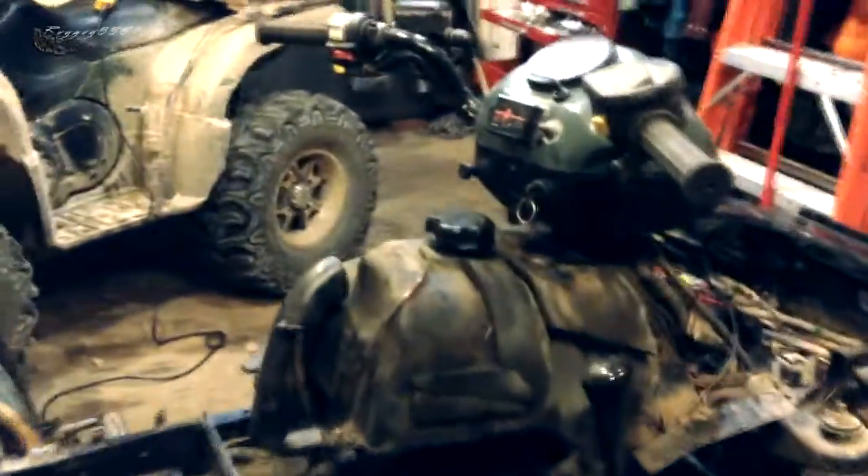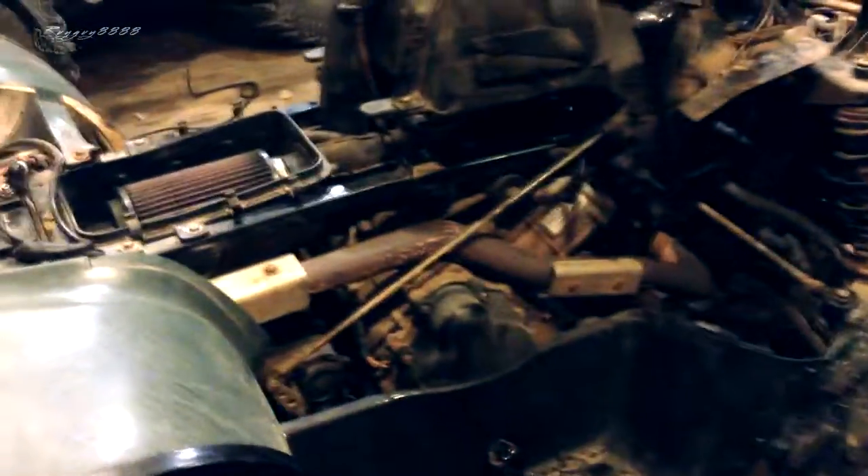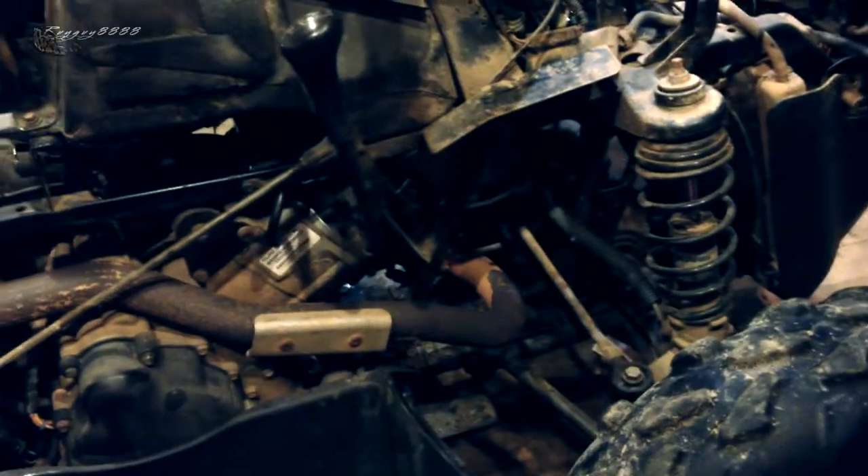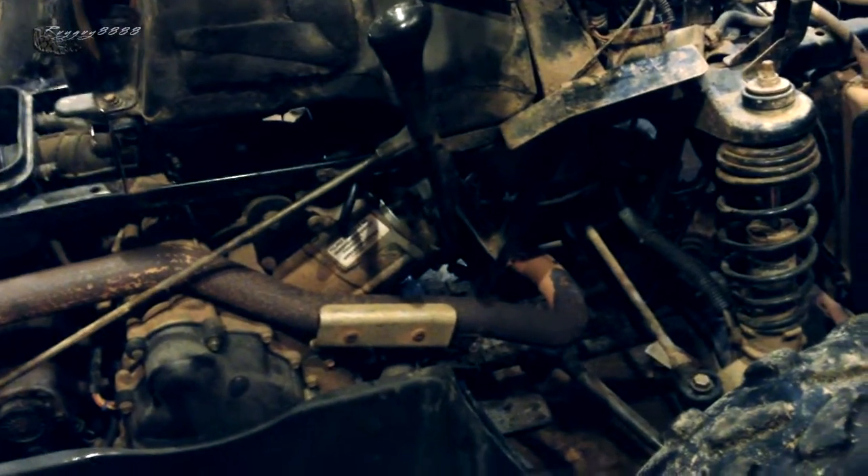The main amount of work that I did to it was the ignition system. I ran a whole bunch of tests — compression tests, inline spark tests, spark plug tests to isolate any issues with the spark plugs. I did a leak-down test to make sure there's no coolant getting in at the top and fouling the plugs.